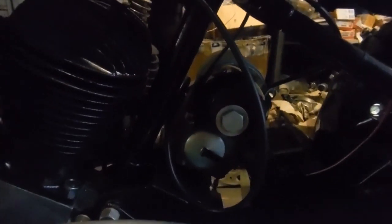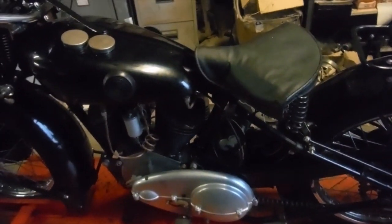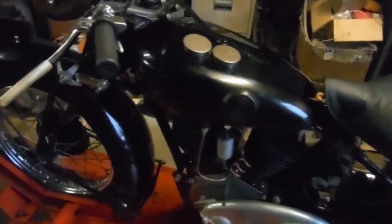And the dynamo's there. And there's the battery box. There's no actual battery on this. It's got one of those Boyer power boxes to control the voltage from the dynamo. So there's no battery, so no lights or anything when the engine's not running. And the guy who helped me out with this one, he was here helping me out for a little while, a friend, Joao, he did the electrical work on this and did a nice job of it.